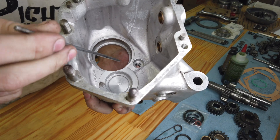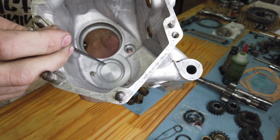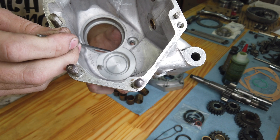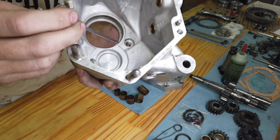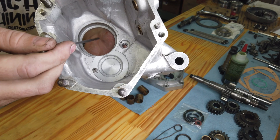It's almost guaranteed that this small bit between the two bearings — the main shaft bearing and the layshaft bearing — is almost always cracked. It's like a guarantee. This one's not cracked yet, so I'm going to be very careful when installing my bearings. I'm going to warm these up just a little bit — doesn't take a whole lot, but just enough to kind of help with that bearing install.